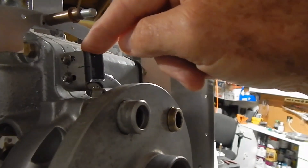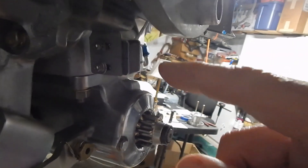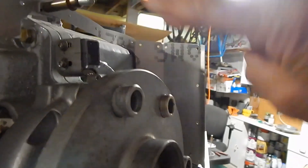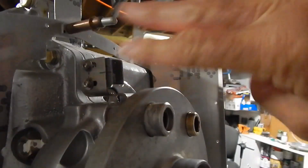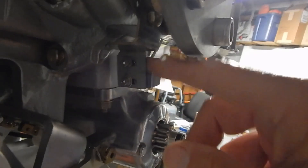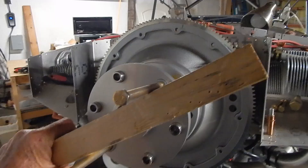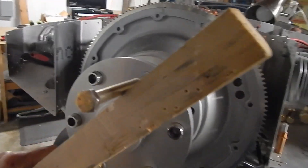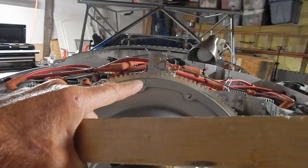So what I'm going to do is take this known-good sensor from up top and move it down to the bottom bracket. If it produces spark, that tells me the bracket location is not the issue. If the working sensor does not produce spark down there, that tells me the bracket is probably out of alignment — because it's the same magnet spinning around sending the signal to the sensor. If the signal isn't reaching the sensor in the lower position, that means the sensor is not positioned correctly, which would lead me to the next step of figuring out how to correct the bracket.